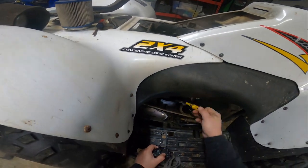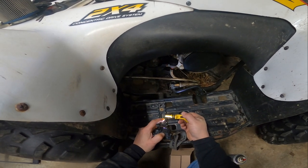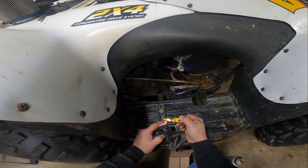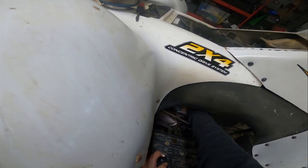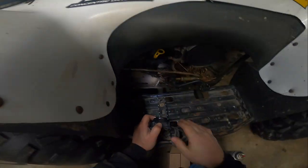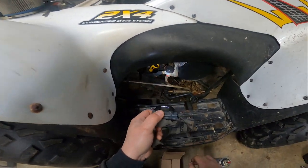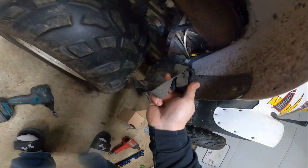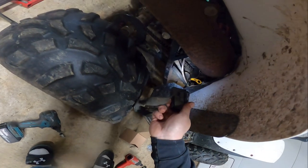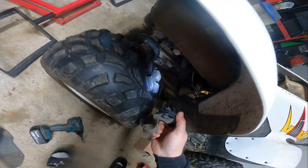The other point of contention here, where the problem is, no oil in there. There's no oil on that transmission. So, you need to get some oil on that. Yeah, they may have a leak somewhere here that's causing that. Probably in the pinion there.